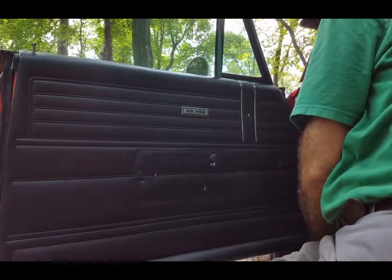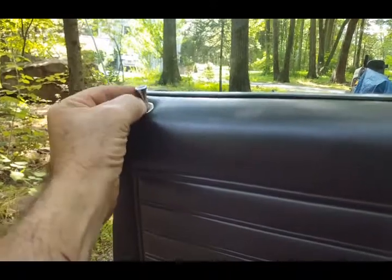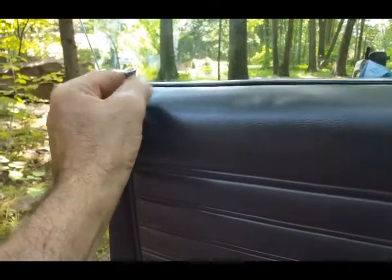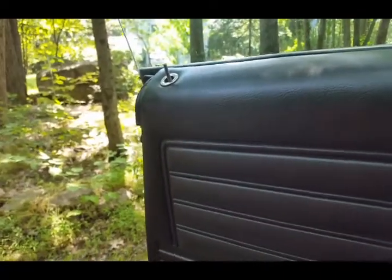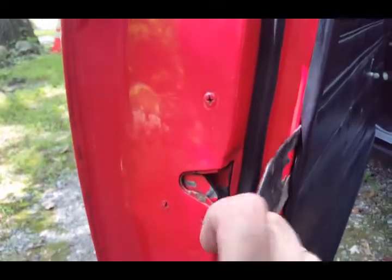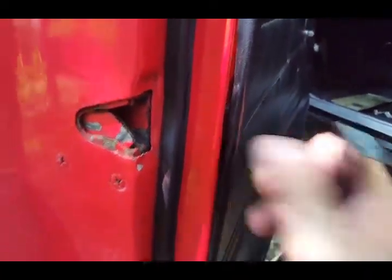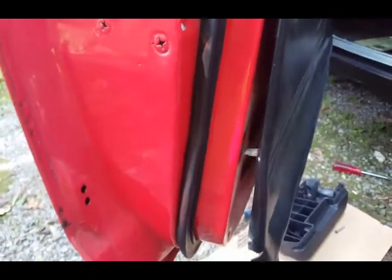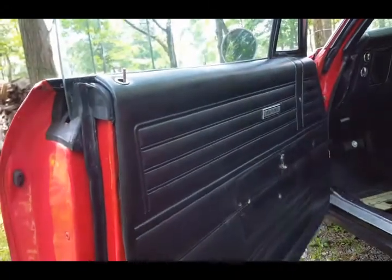This side is completely free. Now I'll do the other side. Remove this part here — the little latch — to free the door panel. Looking right in here you can see the clip I mentioned on the other side. Gently stick your tool in here and pry away, and you'll see it hit those clips. There are approximately three clips on each side, maybe four.